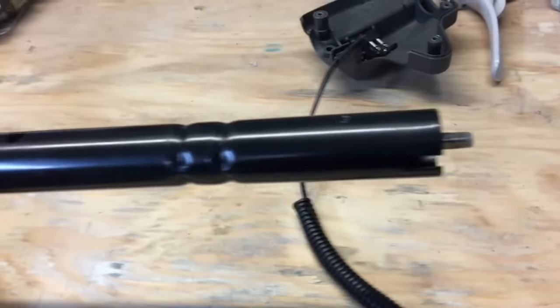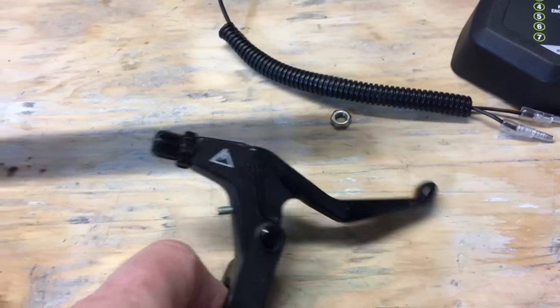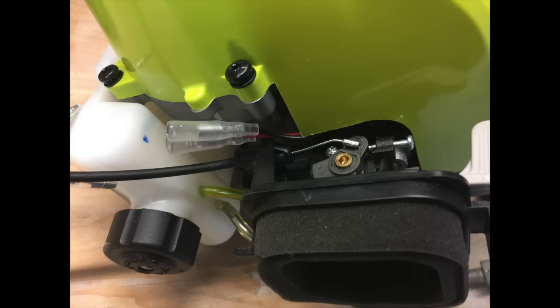I'm going to use a trigger instead. Here we have the trigger — a very simple arrangement but much more efficient than the original for this job. Here you can see the shaft has been pulled out of the engine and the rubber handle pulled off, and also the throttle cable is now free. So we'll start to take that apart and take it out of the actual carburetor arrangement.